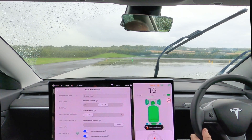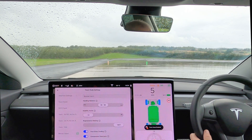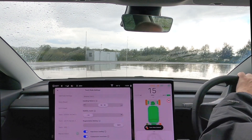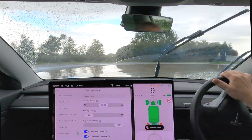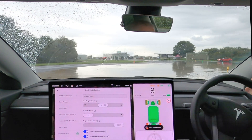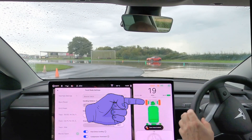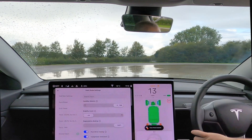If you're lucky enough to have a Model 3 Performance, you can put it into track mode and play around with various settings, including dialling down the stability control — as I've done here to minus 10. It makes it a little bit more of a handful but as you can see it's still very controllable, and it is definitely worth trying this out on a skid pan if you can. I wouldn't recommend trying it on the road though. You'll see on the graphic in track mode that the tyre slip is being displayed and you can actually see how much grip you have on each individual tyre — it's quite interesting.